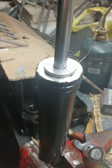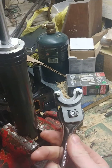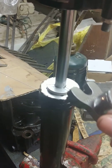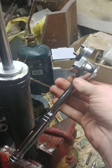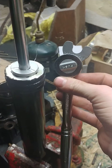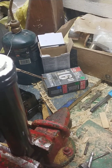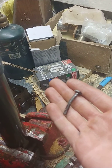To take this part further, you're going to need a specialty tool, unfortunately. This tool is about $55 on eBay, and it just fits inside of the holes on the top here and lets you hook up a socket wrench so that you can untwist this. Mine was extremely tight — I could not have done it without this. I did try using other methods such as a couple of bolts in there, but it ended up just bending them, so that's definitely not the way to go.